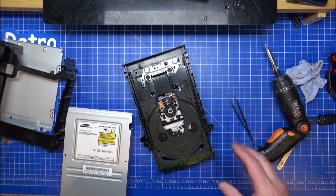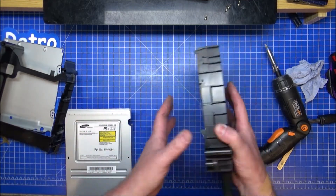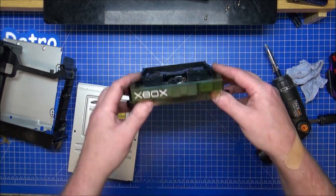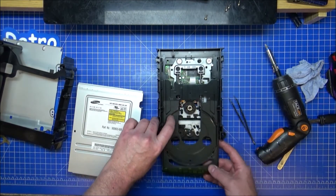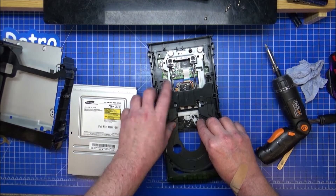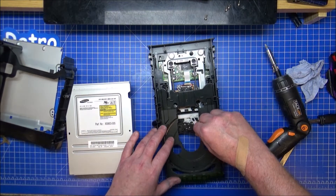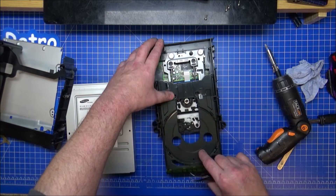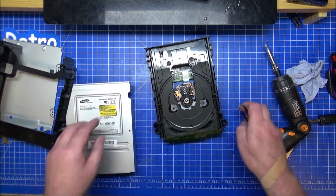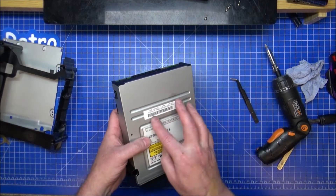This is the DVD drive — this is a Samsung one, because it says Samsung and it's got two cutouts there. The top will lift off. If you take the bottom, there's four screws holding the bottom plate in, and the top will come off anyway because that's holding through on all four sides. You can open the drawer by pressing this white button inside, which will pull that open. Give it a good blowout. At this stage you can quite easily replace this belt — that's one of the main problems that keeps cropping up, if that has stretched or started to degrade. At the moment that doesn't look too bad. There's a tiny bit of give in it but it feels quite tight on opening and shutting, so I'm going to leave it as is. Blowing out the insides, everything seems fine. I don't need to clean the lens. So that is going to stay as is since January 2003.